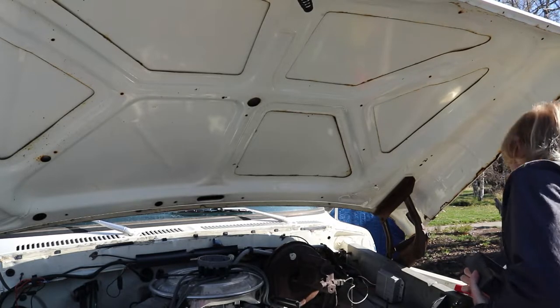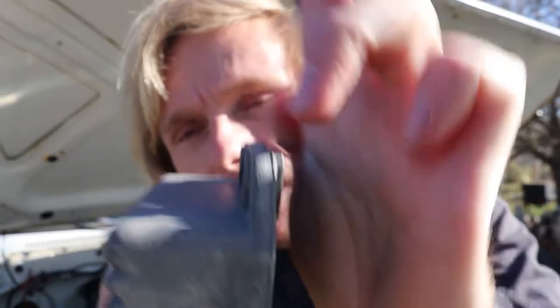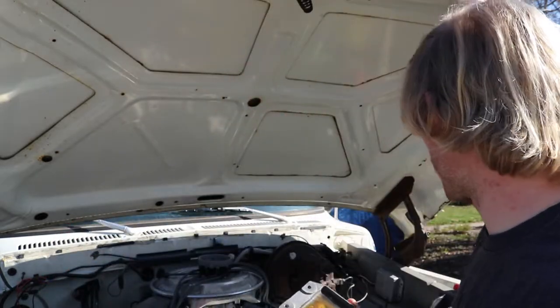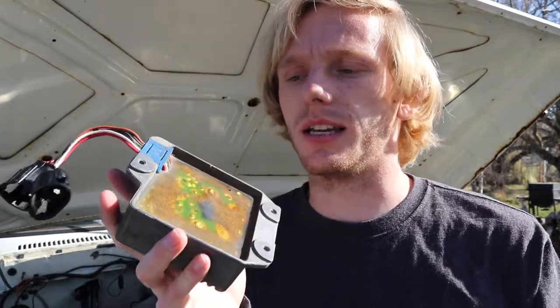This is actually a Motorcraft one, which is crazy. I keep it, but this one has a weird problem where it will have no start — just crank and stop, crank and stop. If you crank it long enough it'll start but it's an awful start. The number one solution for these is spacing the back off when you mount them. On my truck I have three washers per bolt, so mine is spaced out about a quarter inch, and it's up on the fender where it stays cool. Always carry a spare. If you ever see the potting material melted out of the back, replace it.